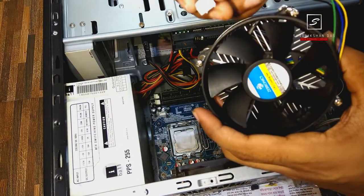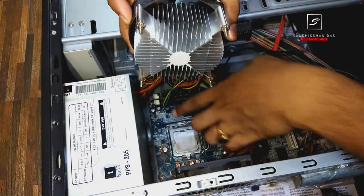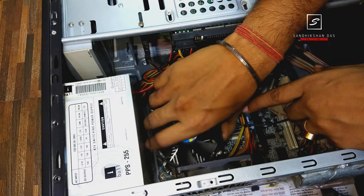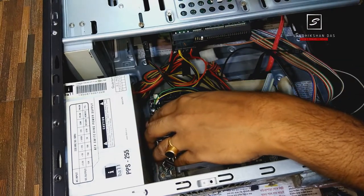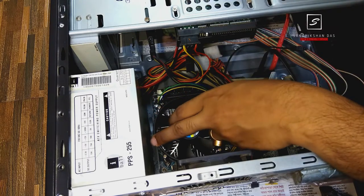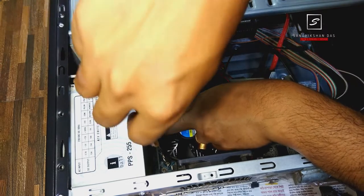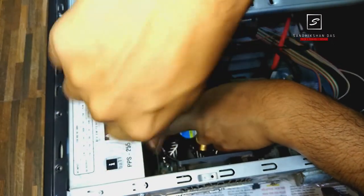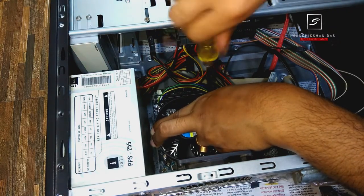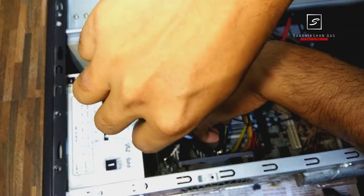Attach the power connection of the CPU cooling fan to the motherboard CPU fan pin gently, and place the fan on the processor by doing exact alignment of the 4 fan screws with the motherboard fan screw holes around the processor slot. Now, holding the fan firmly with one hand, use the other hand with a screwdriver to tighten the screws. Don't tighten a single screw all the way at one time — do it in rounds, meaning tighten each screw two turns then move to the next, until all 4 screws are evenly tightened for a proper parallel fit. Otherwise one side will be tight and the other loose, which will prevent proper heat transfer to the metal portion of the fan.